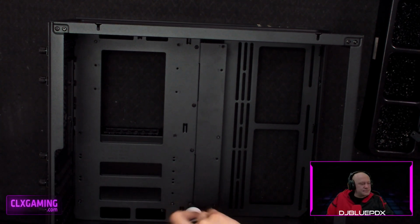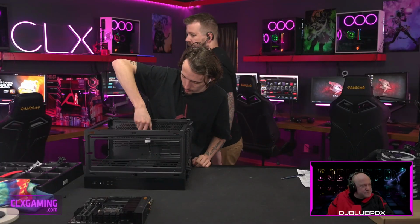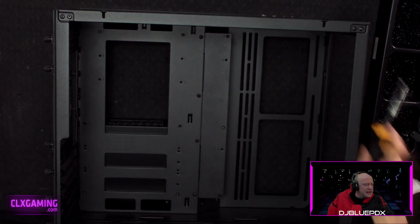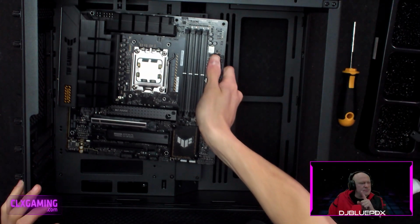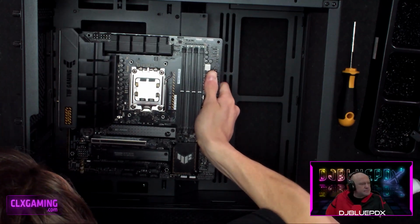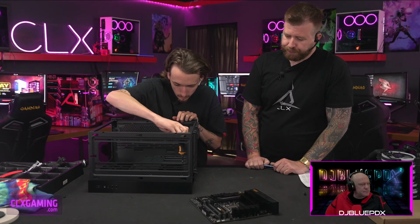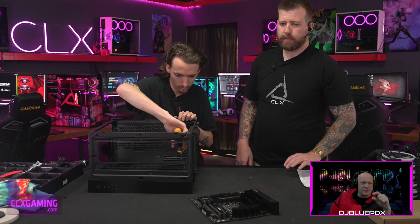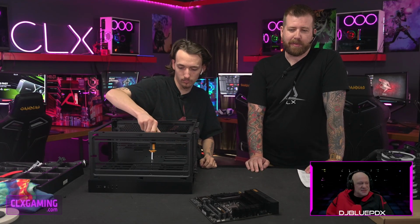Okay, gotcha. This might be the most standoffs we've messed with in a build on the show before. There's a special standoff driver. It's a 5mm hex head, if you're curious. We just buy these standoff drivers that are 5mm hex head. Now, is that like the ones that have the pin in the middle? These do not. No, there's no pin in the middle. So just any standard 5mm wrench would work on these. Got it. Because I've had those Star Drive screws that have the pin in the middle. So you've got to have one that's got an empty spot, specially made for it. Yeah.